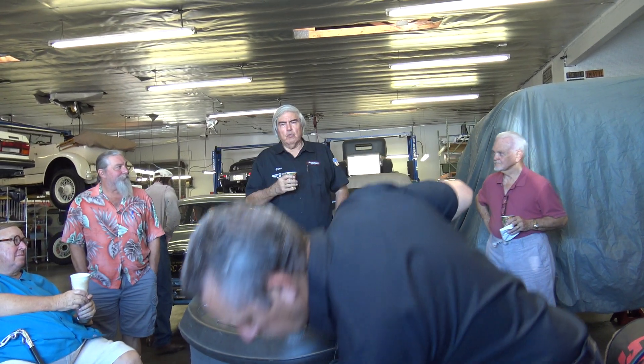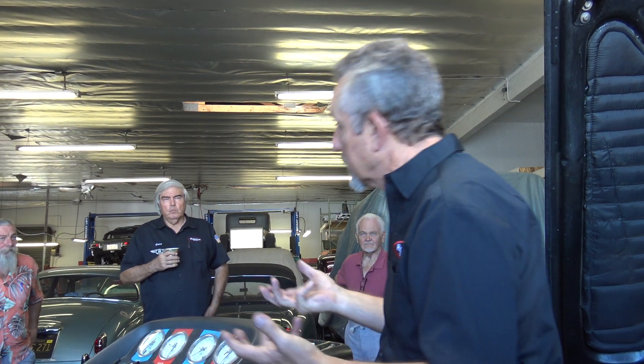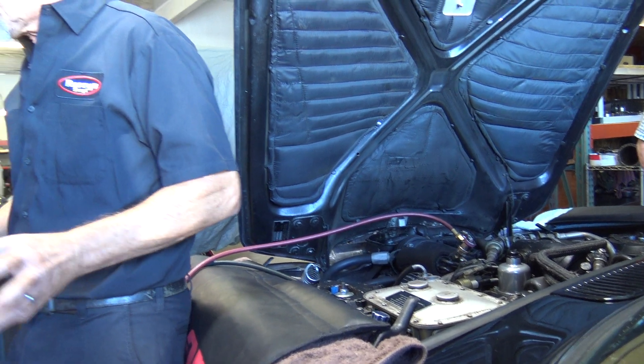Question from Gene: do you ever have to replace the dryer? Great question. The dryer takes moisture out of the system — because moisture will get in there — and it also filters it. There's a desiccant bag and it goes through a little screen. So it is a good maintenance item. Whenever a compressor is changed — that's the main part of the system — if it's an R12 system it's always best to convert it to 134, mainly because of cost. That's the best time to go ahead and replace the expansion valve, which is a small orifice, and the dryer, then flush out the system for any residues and dirt.